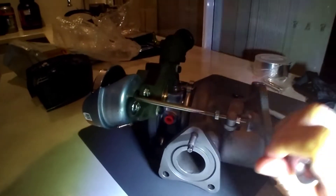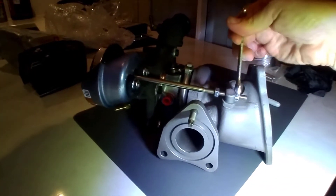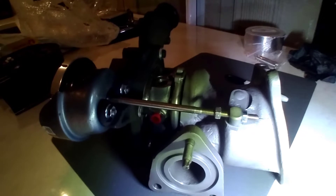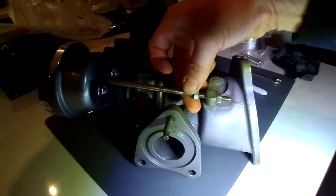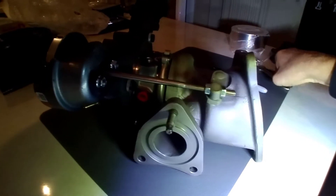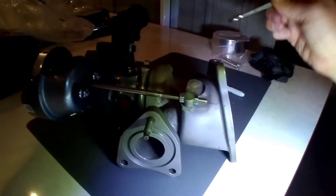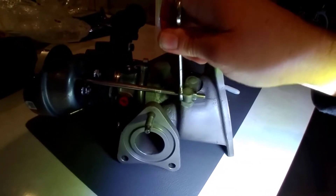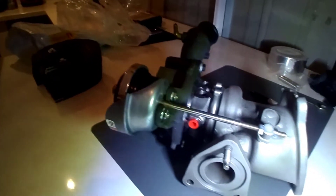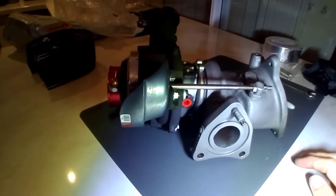We want a 10mm bolt. I'm going to turn it so that it's back facing me — that's one full rotation. And now we just screw this locking nut so that it's in place and give it a little bit of tension as well, so that's in there tight. That's basically set it now to 10 PSI, which is what Puma Speed recommend as the ideal setting for the 11 PSI spring wastegate actuator.